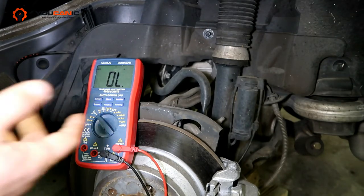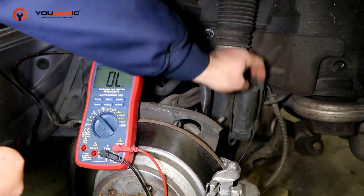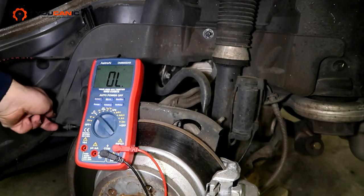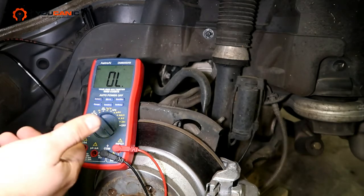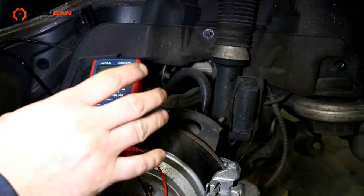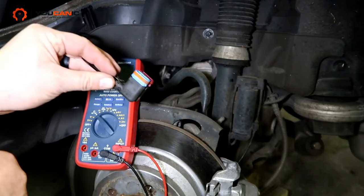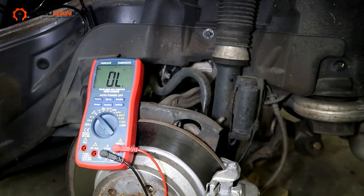If you have no continuity and can't measure any resistance, you may need to replace the component. You can open the piece and check for corrosion, but most likely if you have a faulty damper valve you'll have to replace the whole air strut. If your suspension is really stiff and stuck on sport mode, this is the most common problem. You have one damping valve on each of the four air struts, so you'll need to read the codes to find out which one is faulty. This connector pairs with the ABS sensor — you pair them up, plug it in, and that's it. Thank you for watching.